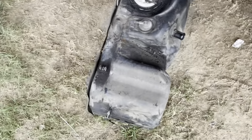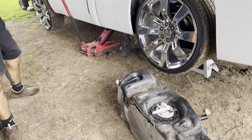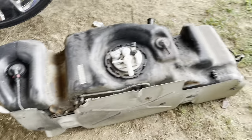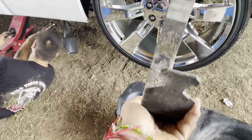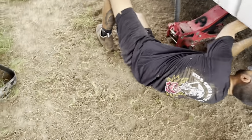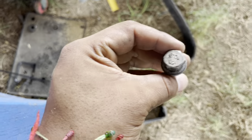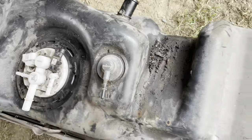You hear that gas? You see the gas tank is down. The only thing you gotta do is just take that one bolt off — give yourself a 15. The gas tank will fall down, so you have to put a jack under it and slowly take it down and disconnect all these little things — all these wires and hoses that are in it.